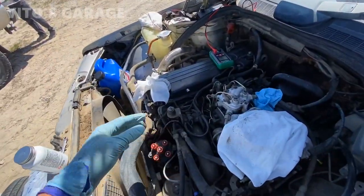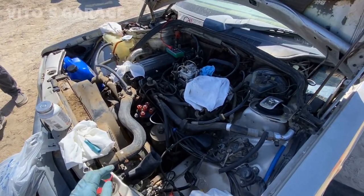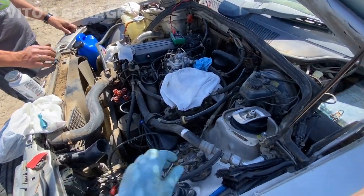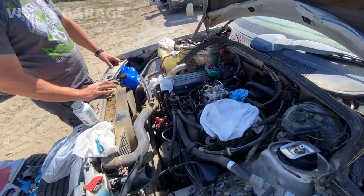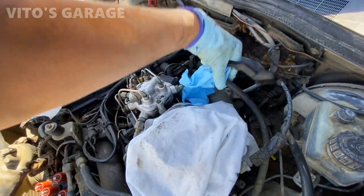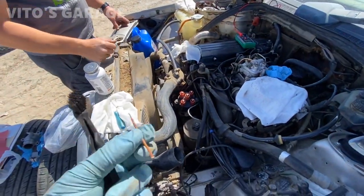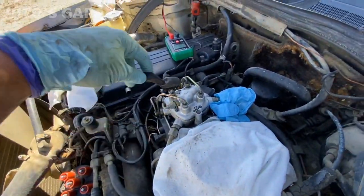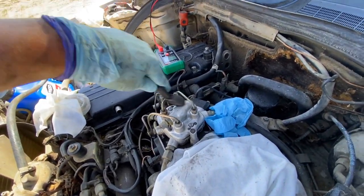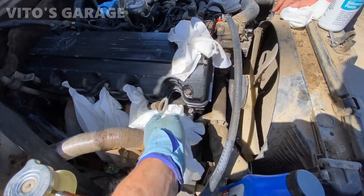Here's why we're not gonna change the engine oil just yet. Engine oil is still fine, still a little bit above minimum, so it's okay. But the previous owner said there's a leak coming from somewhere — that's why I don't want to change the oil just yet. We got fresh oil in the trans. And now this is the fuel line that comes from the fuel pumps, so we're gonna activate that fuel pump using the jumper wire. Then we're gonna connect it and open these four lines to make sure there's no gunk in there.